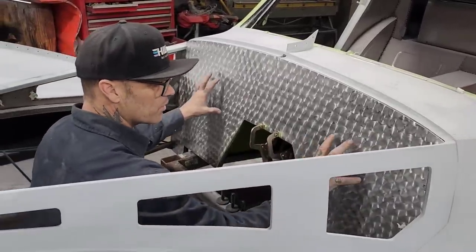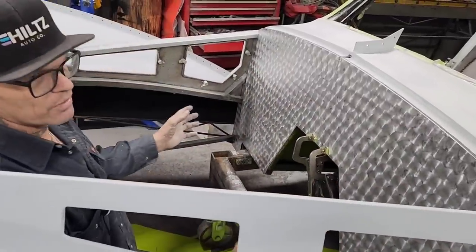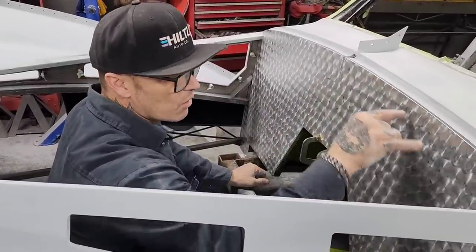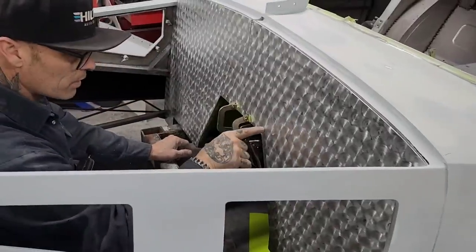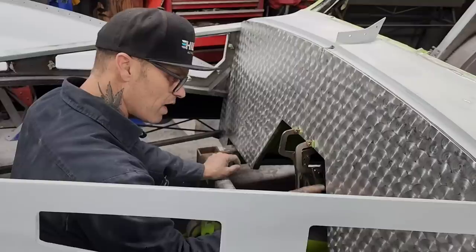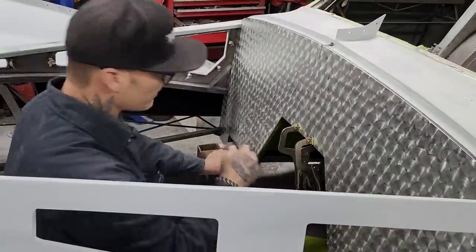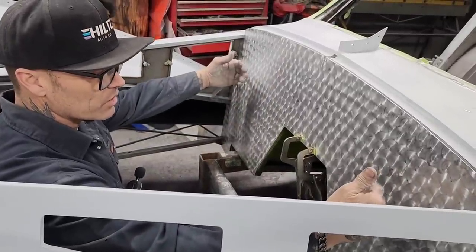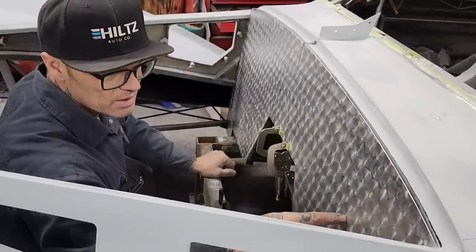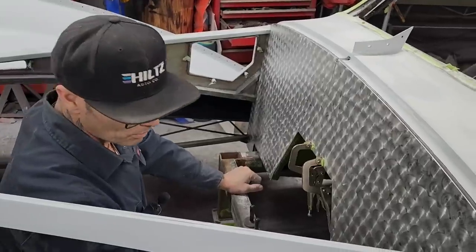But as I'm putting this on here, I could have used a sticker and put a vinyl wrap on that and made that absolutely look perfect because them circles on them ones are perfect. But when I screw this to the edge all the way around on this firewall, I'm thinking it's going to make the firewall stronger for the brake system. The reason being is because the edge on this firewall underneath this piece of metal is welded all the way along the edge, nice and tight and right. It's just that the metal on it is a little bit flimsy. But when I put this 14 gauge aluminum on there and connect it all the way to the outside edge, like the 18 gauge underneath of it, it should be a fairly strong firewall, with not a whole bunch of flex and bend.